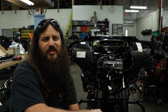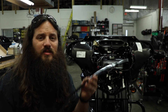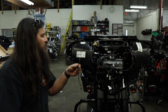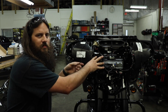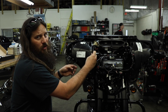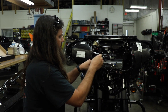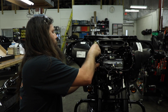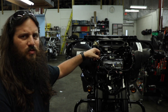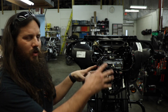With one side done you do have to do the other side. Pro tip: go ahead and mount this loosely so you have a good idea of how to route the harness. I don't want to zip tie anything to the outer fairing because then my fairing would be zip tied to the bike if I wanted to remove it again. I only want to put zip ties on the part that's going to stay with the bike. Throw an included zip tie right here on the harness. I try not to zip tie wires to any metal part or braces because over time it could wear through the insulation — keep it routed with other pieces of harness.